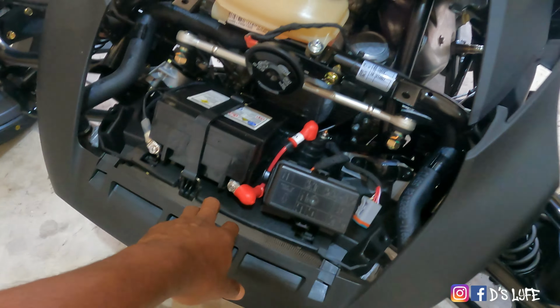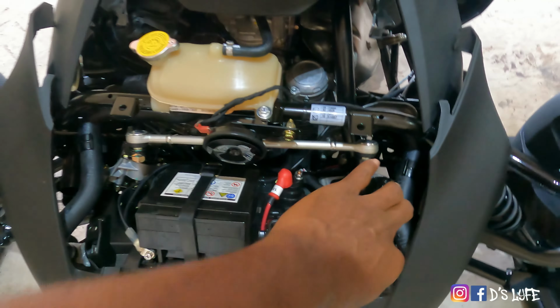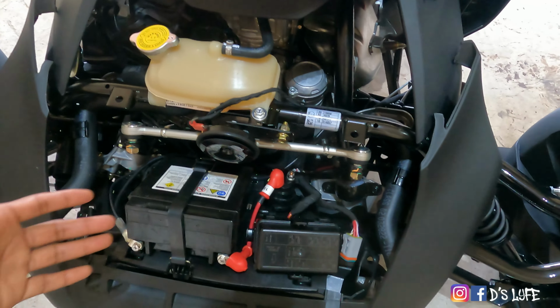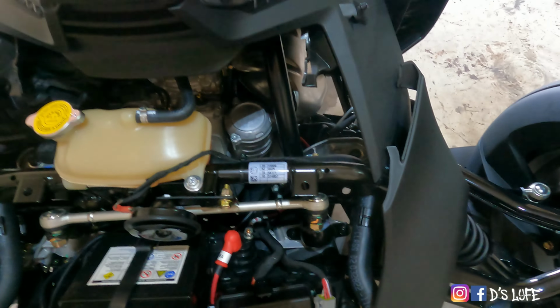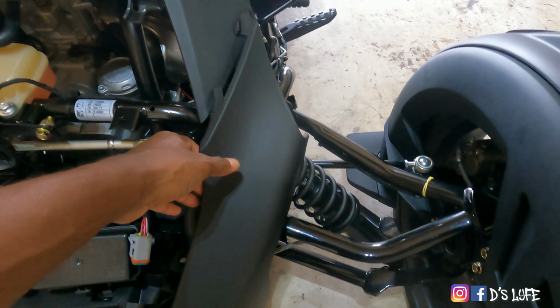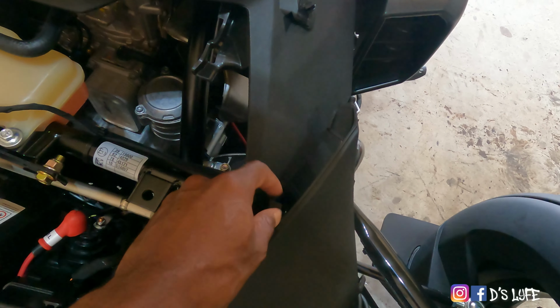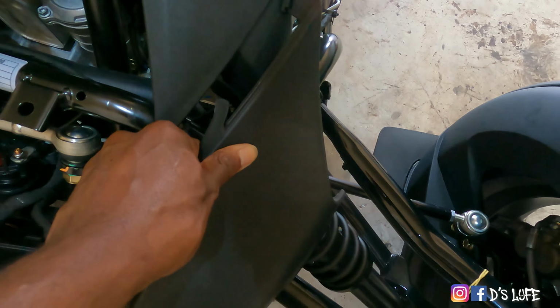Basically, I just went ahead and got some of the body panels off and took the hood off here, which is pretty simple. You have to grab it from the sides of these little cubbies, and there's a little tab up underneath that you have to squeeze up towards you. Then you pull it off and it unsnaps from here. It's just a little bit of finagling.